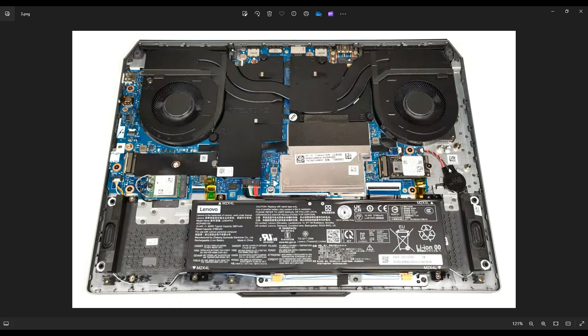This is your CMOS battery right here. It's wrapped in black electrical tape, stuck down to the computer by double-sided tape, and it plugs in right here. If you're here to replace it, you can easily just pop that up with your fingers — it's only double-sided tape — and then unplug it from here. Just like the battery plug, there's a grip on either side, so you can use a pry tool to jimmy that out of that port. I'll have a replacement CMOS battery option below in the description with all the tools and replacement parts.